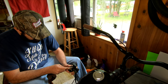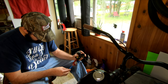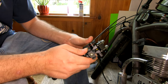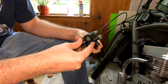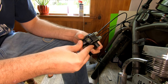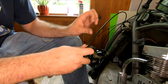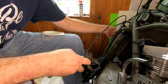Before installing this unit onto the bike, I'm going to remove the main bolt for the throttle bracket and loctite it, because once during a ride I had this come loose and I no longer had throttle. I'm not a big fan of thumb throttles due to the fatigue they add during long rides, however I outweigh that with how convenient and clean this unit is. It's important to note that this particular braking unit applies even pressure to both the front and rear tire via a teeter-totter mechanism - once pressure is applied from one cable, it'll rock and begin to apply to the other. I don't recommend trying to work around this.